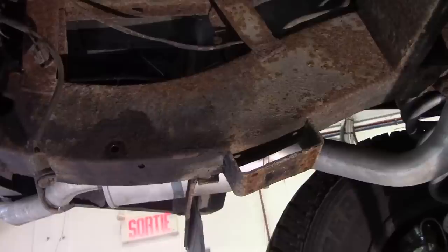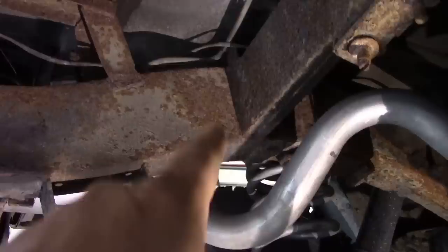Let's start with the old favourite: the crossmember. Whoever put this crossmember on did it cheap — they just bought the rear section without the extensions. If you're going to do this, get the ones with the extensions and pay that little bit more. It's so easy to weld — you weld up here in this corner and just around where the spring mount is. If you drop the fuel tank off, welding is a dream. This guy did it cheap and it's hardly welded on at all.